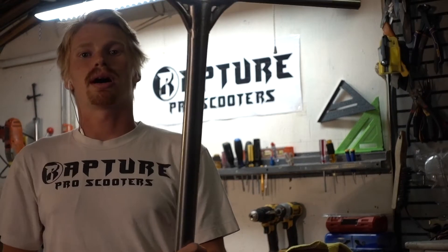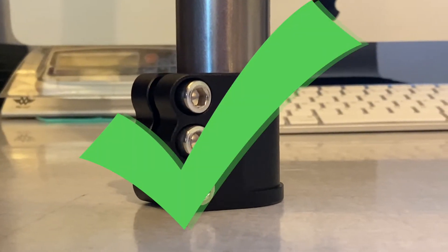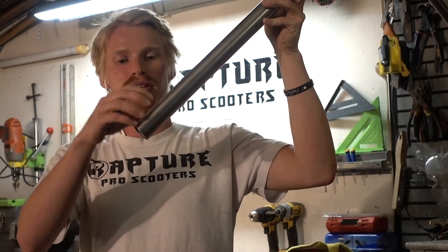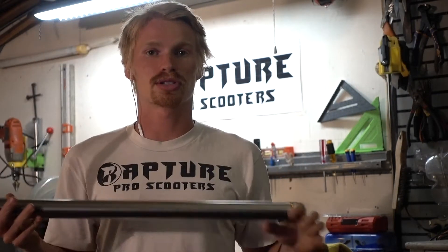I really want to make an important point here: your slit should not be taller than your clamp. If your clamp is 1.8 inches tall, your slit should be no taller than 1.7 inches tall. You always want your slit completely covered by your clamp. A good rule of thumb is if you can see your slit at all through your clamp, you're not riding the right clamp. You need the slit completely enclosed by your clamp for structural support — it prevents stress cracking and makes your bars last a lot longer.